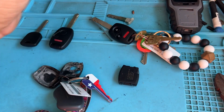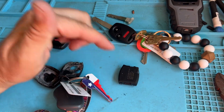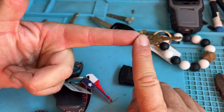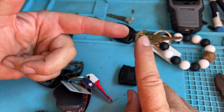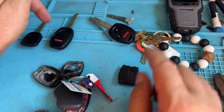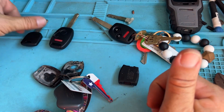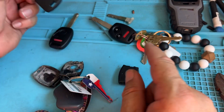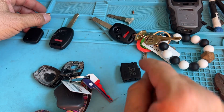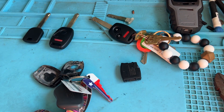Now it's able to be that remote immobilizer module. Hopefully that makes sense — it's really useful when it comes to cloning those older Honda keys. So again, A/B/C: the Smart Pro didn't work, the OBD port wasn't connecting and automatically failing. So we programmed the remotes manually — four times unlock, four times — all that. We cloned the regular chip, but we had to take the original one off and cut the plastic to make the Xhorse chip fit. Thanks guys, see you later!